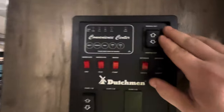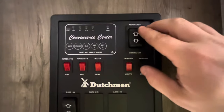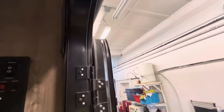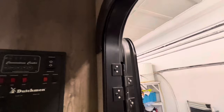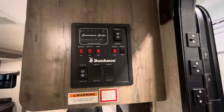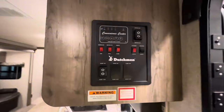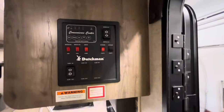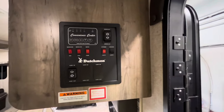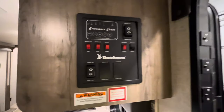You have your awning switch here — extend and retract. These awnings don't stop on their own, so watch it while rolling out. There'll be a valance that folds down; once you see that valance, let off the switch and you're all set. If it's really windy or starts downpouring, roll the awning in to avoid damage.